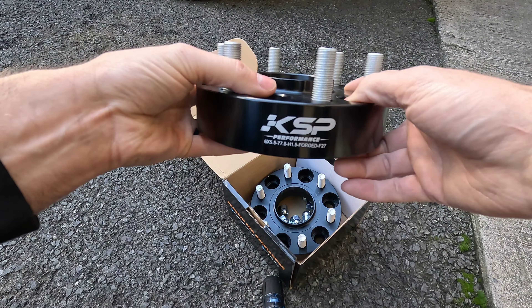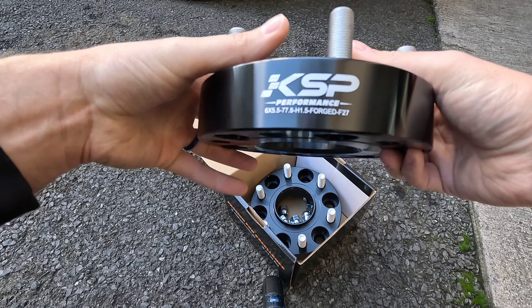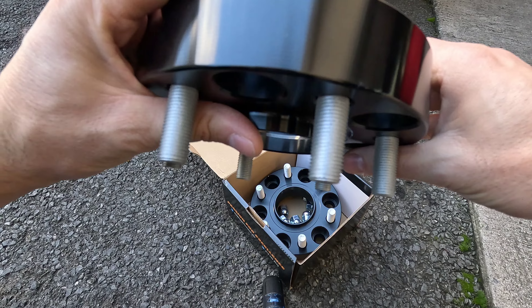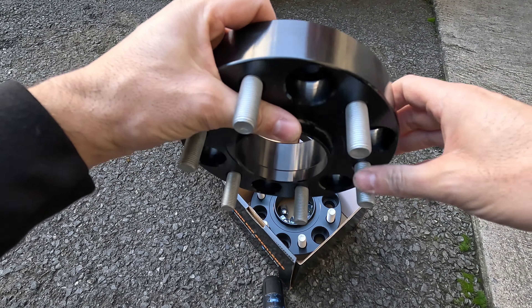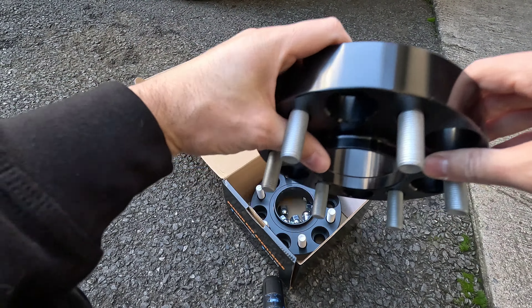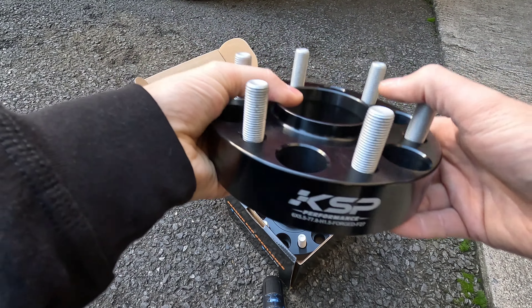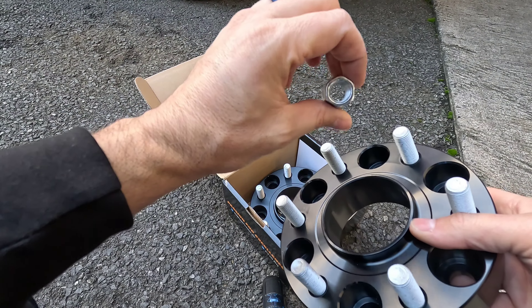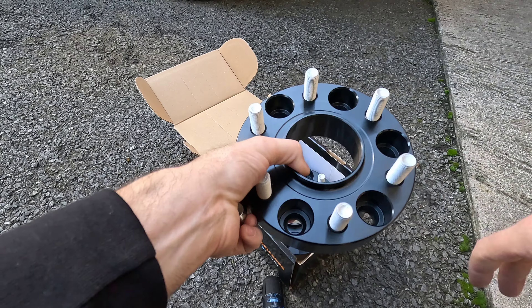So here are the spacers - I went with the KSP 1.5 inch spacers, Amazon specials. They seem to be really nice construction, the studs look to be of OEM quality. I believe they're a little softer based on the torque specs, but we'll get into all that soon. I know a few guys have been running these things for years without any issues, so I don't see myself having any issues either. These are only going to be on for a few months - just the winter months. It comes with 19 millimeter lug nuts to hold these on to the factory studs.